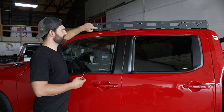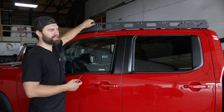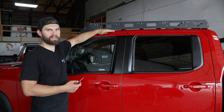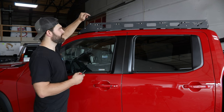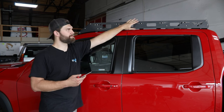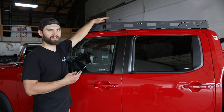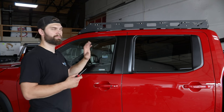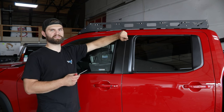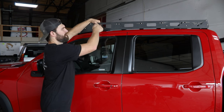For this step, you'll want to make sure the side mounting hardware between the fairing and the bracket is just a little bit loose so that you have the vertical adjustment available to you. Then it's really just a matter of lining the side rails up to the roofline, making sure they're parallel all the way along, and checking clearance in a couple of locations. One of those will be the sunroof or moonroof, if your truck is equipped with one, to the upper crossbars — specifically the second and maybe third one, depending on the locations you have them. That's only going to be a factor in the vent feature, and you'll want to check both empty and loaded depending on what you're putting on the rack. The only other location that may come close to contacting will be the shark fin antenna at the center of the back of the roof to that rear crossbar — so just pay attention to that one as well. Then just line it up parallel and snug these up on both sides of the vehicle.